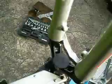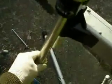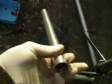Okay, I'm going to tip the oil out of the shock now. Not that it appears to be much in there now. Right, turn the forks upside down so it's easy to get at this knob on the bottom, the rebound adjuster. So I'm assuming that pulls off, which it does. And then we've got another 12mm nut in there to undo. I found you had to turn it with a spanner and hold your finger up in here to hold the cartridge, stop it turning, and it undoes then. So just get that apart. So the nut is off, and out comes a rebound cartridge with all the oil that's dribbled out into the bottom of it. And there you can see the problem, it's just unscrewed there.